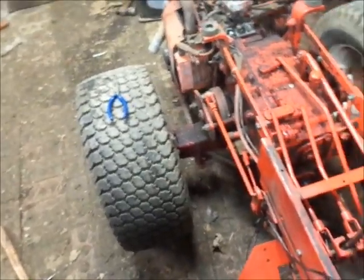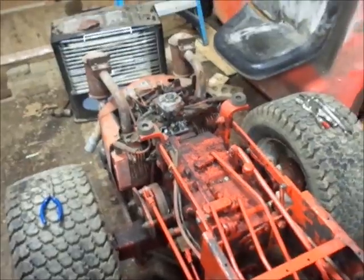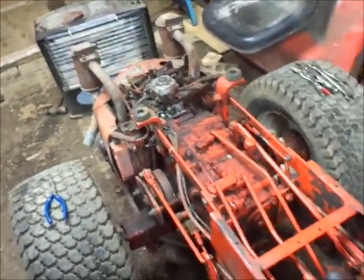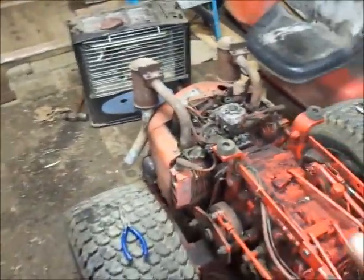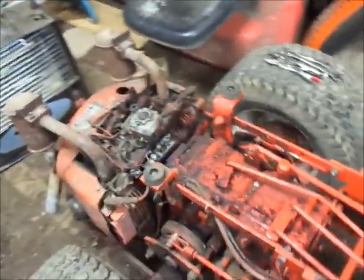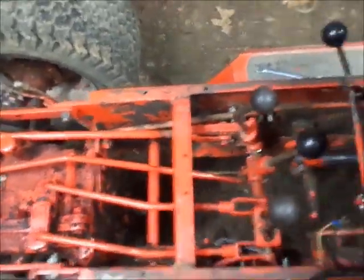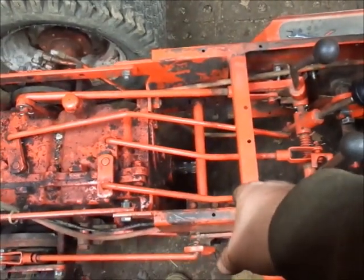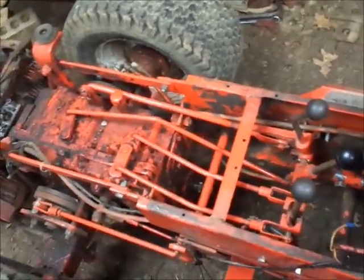I'm wondering if the springs were missing underneath the clutch, it wouldn't come out at all, because it's not held over this way by anything except the springs. So I don't know. It could be. Maybe I have this a little too tight down in there, but I only went down to the ends of the threads. So, I don't know.